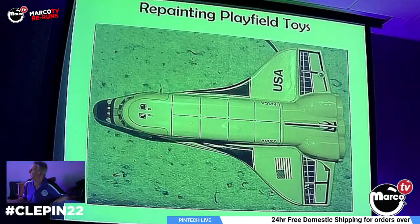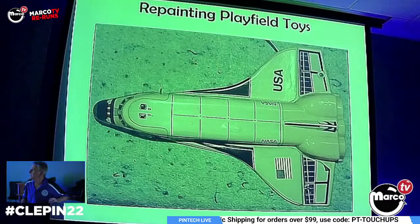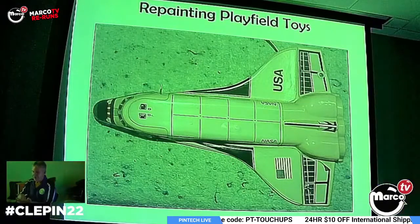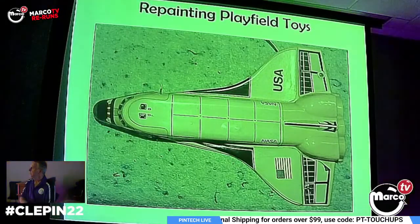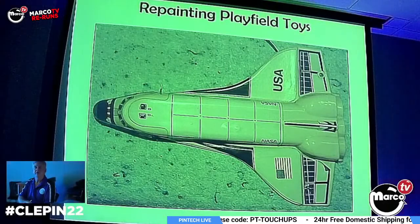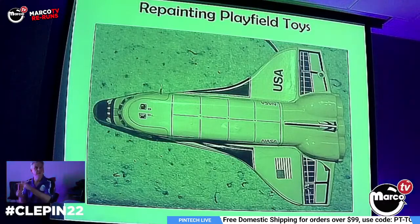So I was actually able to pull those off and use the 3M 467MP clear adhesive. It's a double-sided adhesive kind of stuff. I took naphtha and I cleaned the back of these. See how it's black there? That's the adhesive that's gotten all this black soot from the playfield. And you could turn that over and hit it with naphtha and clean the old adhesive off, and you had a nice flat vinyl decal again, ready to go.